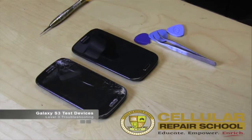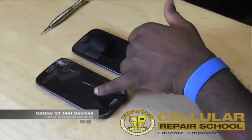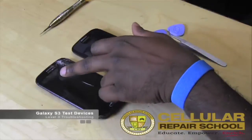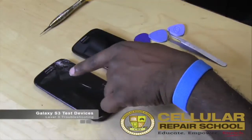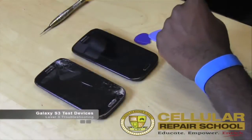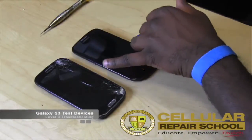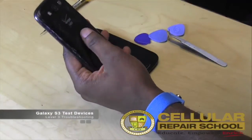The first part of any assessment is to just look at the device. Just looking at these devices, you can tell a lot. This device I can tell just by looking at it has some oxidation issues — it has come into contact with some liquid at some point. I can also look at this device and tell that right under the screen the LCD has some trauma or buildup between the glass and the LCD. I can also tell this glass is broken, just by doing a visual assessment.